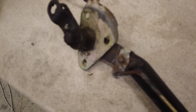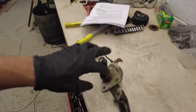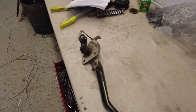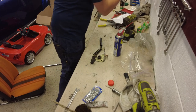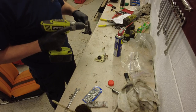Here's the handbrake lever itself now. The reason the button wasn't protruding fully was actually simple - this piece, the hand grip, had slid up, so I was able to slide it back. Now we can see there's our little ratchet pawl, and it's quite tight to move. What I'll do is undo the nut, take it off, clean it all up, put fresh grease on, and put it back together. Then our handbrake lever is good to refit to the car and we can worry about the cable afterwards. I'll get the wire wheel onto that and give it a tickle, then grease it up.